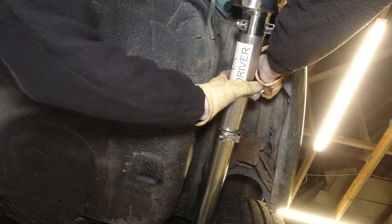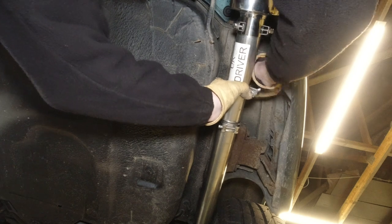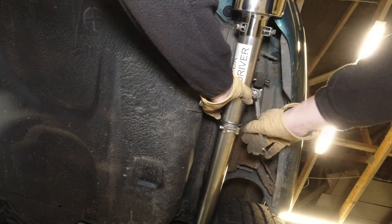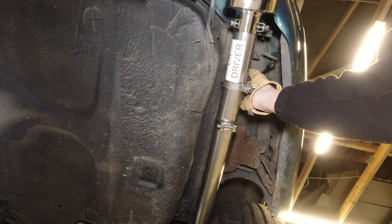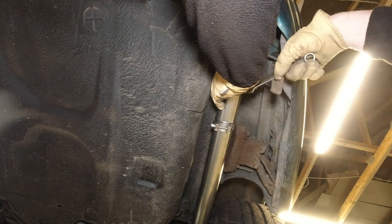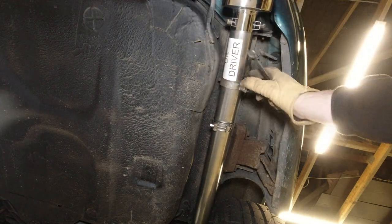That is going to go onto that peg up there, like that. And then we can start adjusting and tweaking this into position using the bracket, because you can see we've got this too close to here. All I've got to do is slacken off the hanger. Rotate it like so, and it pushes the exhaust further off in that direction. There we go.